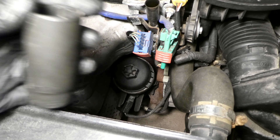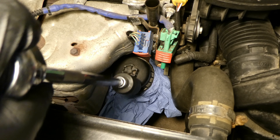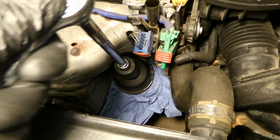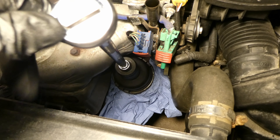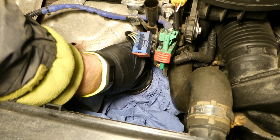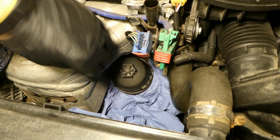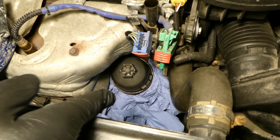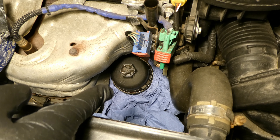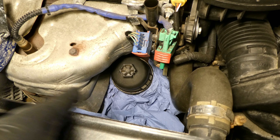This is a 27mm socket. I've loosened it almost completely and now oil is starting to drip into the pan, so I'll leave it another 10-15 minutes slightly open so it drips down and I won't spill oil everywhere.